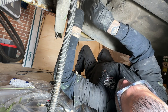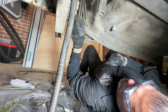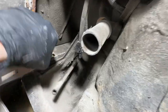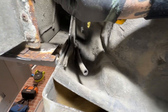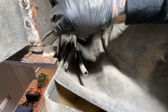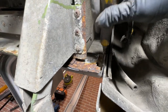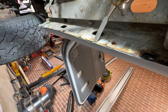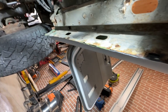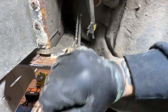Taking these little steps at the beginning is just a great idea. I've got that piece out. Once all these insides are all done, I'm going to grind down this stuff as much as I can, and there will be a rust encapsulator paint brushed on all of this stuff too just to give it some protection. Well, you've got an older vehicle like this, it's going to have some rust for sure, but as you guys can tell, that stuff you spray in there gets everywhere. It's oozing out of all these areas, so you know it's protected even between the pieces. You can see all the green coming through. I'm excited - this stuff makes me feel better that I'm starting up this ambulance build with some protection.